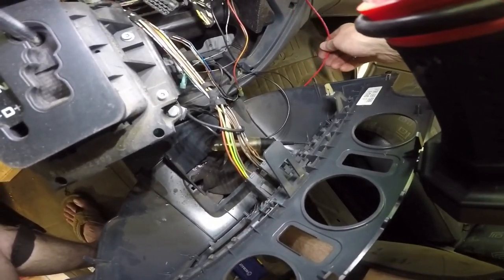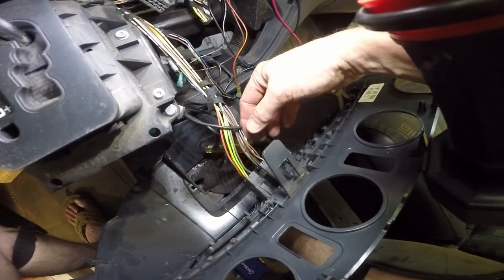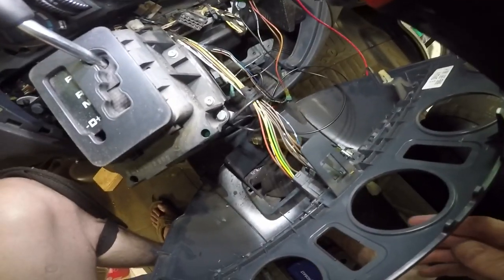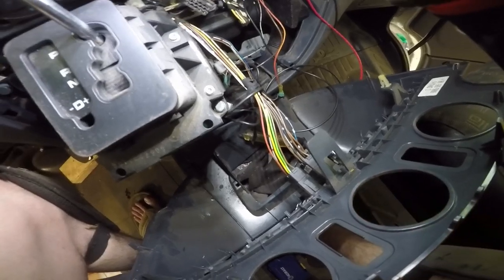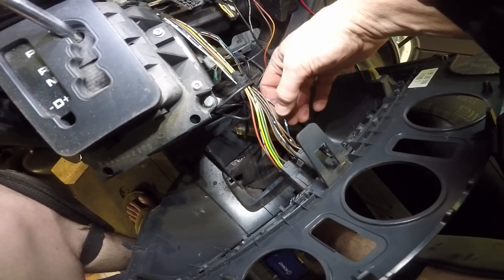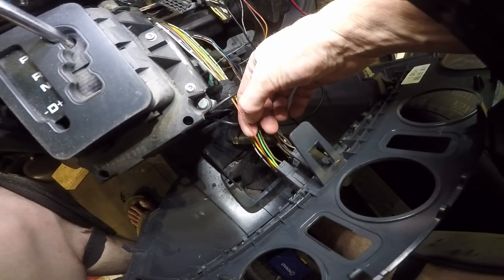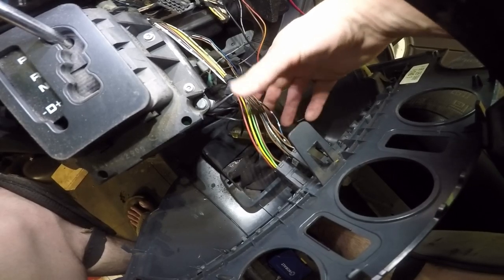I've been temporarily pulling my power off the wires that go to the cigarette lighter down here, but I don't want power on it all the time. I've found this blue wire here that goes to the fan in the back — it has power when the switch is on. So I'm going to pull my power for the radio from this. Now if I want my clock to always keep time, I'll pull power for the clock from the constant power wire. If I'm pulling through these circuits, they go to a fuse, so if I have any issues a fuse will blow.